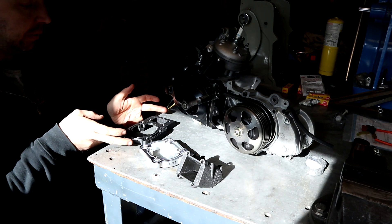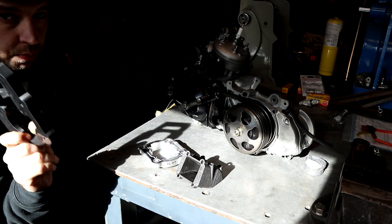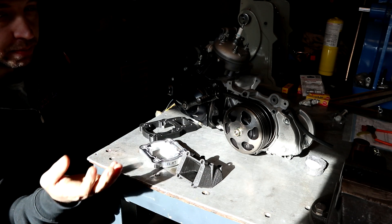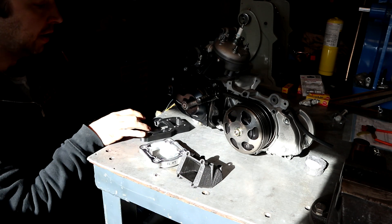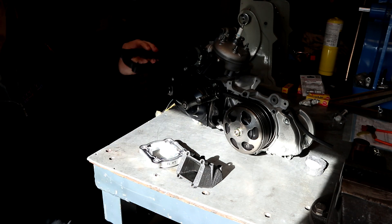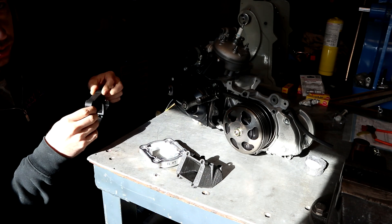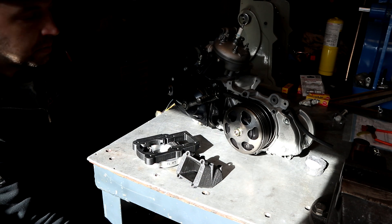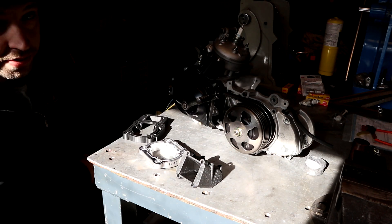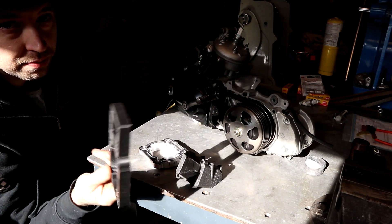When you're getting into the SOLIDWORKS files, if you're wondering what the hell I'm doing and why I'm doing it this weird way — you're probably not wrong. I'm self-taught in SOLIDWORKS so I might do things very backwards. But all the dimensions you need are in there. I will say the base plate height may need to change depending on your setup, so I'd err on the side of making it thicker than needed and then machining it down to get your squish where you want it. These files are all provided for personal use — unless you're Stage Six and want the files to make these for the Honda community, in which case we can talk.